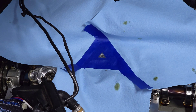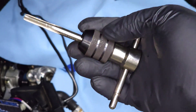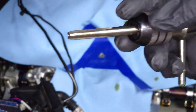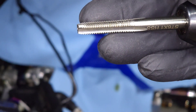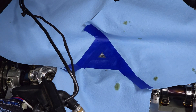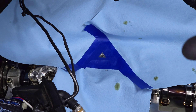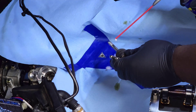The next thing we want to do is tap the hole. The correct thread tap comes with the kit, and I've got that mounted into my tool. I think the tap handle might be the only thing that doesn't come with the kit — I just got mine from Home Depot, but there are options on Amazon as well. This tap is going to cut the threads to fit the insert. You can see all the sharp edges — this will bite in and create new threads. You're going to want to use some kind of fluid. I highly recommend cutting fluid, but I don't have any on hand so I'm going to use WD-40. The benefit of cutting oil is it's a little thicker and sticky, so as you're threading your bit into the hole it picks up all the metal shavings and self-cleans. Spray a little bit on the bit and a little bit in the hole.